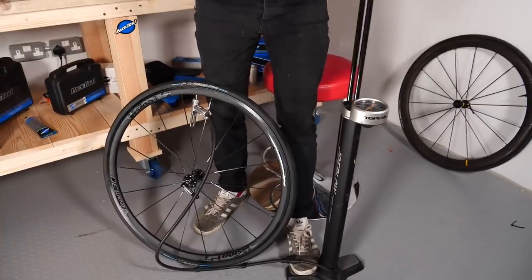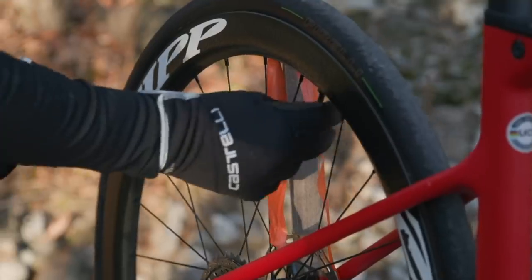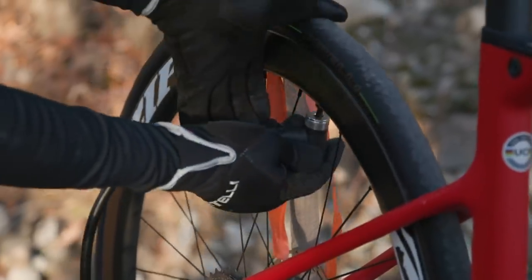If you run your tire pressures too low, you run the risk of the tires coming off the wheels, which you certainly don't want. The risk of damaging the rim is fairly slim since lower pressure alone won't damage it, but you do run the risk of hitting the rim if you hit rocks and stones. The best advice is to stick to what's recommended on the side of the tire and not go lower than what it says.